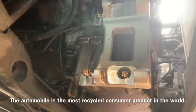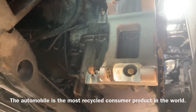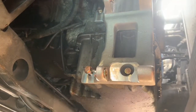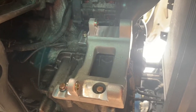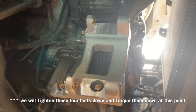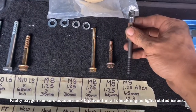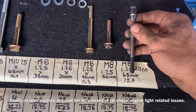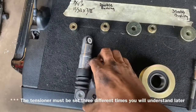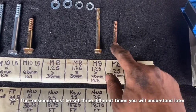According to the documents we tighten the bracket bolts down to 19 foot-pounds — actually 18.75. I'll put the torque specifications at the end of the video in case I misread them. Make sure when working on anything that you start every single bolt in the hole at least a quarter way before snugging down. Now we're going to grab a 6 millimeter Allen along with the Allen bolt and insert it and tighten it down to 19 foot-pounds. We're also going to grab our tensioner.